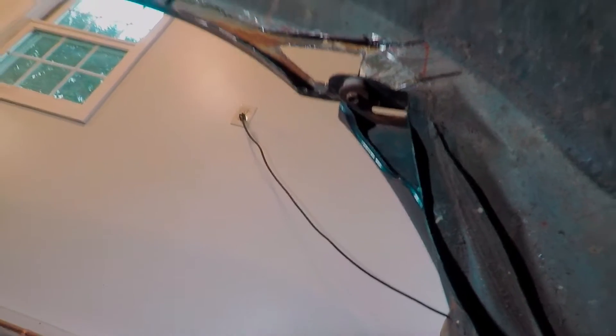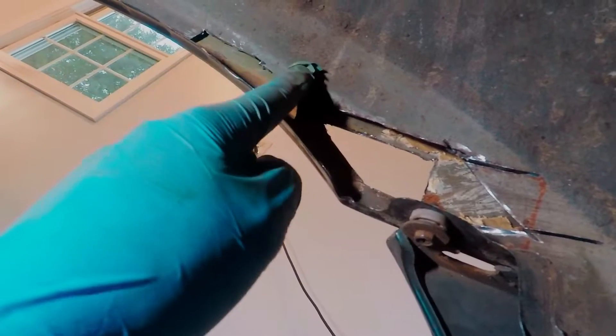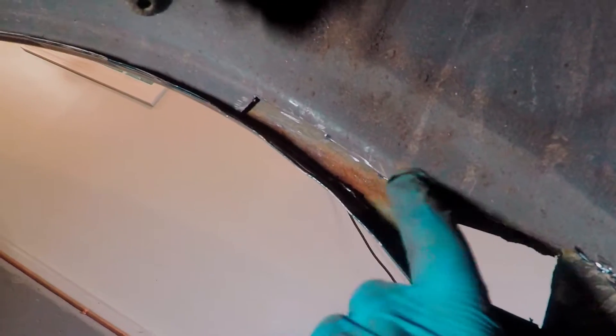You can see the two holes I poked and where I cut through down there - it just looks like seam sealer so all that is the two panels meeting right there, and rust got underneath and actually rusted in between the two panels. We're going to cut out the rear panel and replace that with something, then replace the front panel as well. I've been cutting for a while now, got to the back side, cut out my original area, and then realized the rust continued up this way.